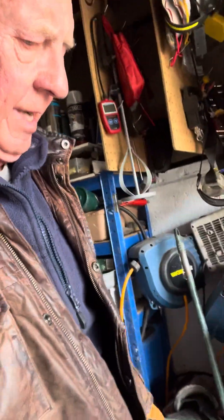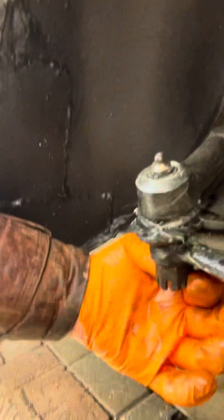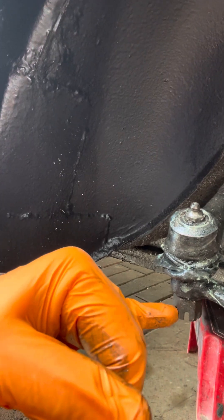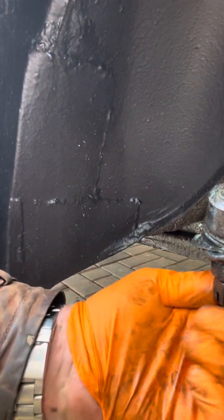Anyway, the long and short of all this effort was I've ordered a dust cover from ESM for that and I'll be taking this apart again. Oh, the other thing I nearly forgot - on the castellated nut of course, one of the reasons for castellating is you can put a split pin in which holds it. Getting the split pin out can be an issue. What you do is make sure the two ends of the split pin are in line and ease them out - it's very soft metal so it might even break off. Ease them out, tap them slightly, and you can get something into the eye and pull it out, then you can get your castellated nut off.